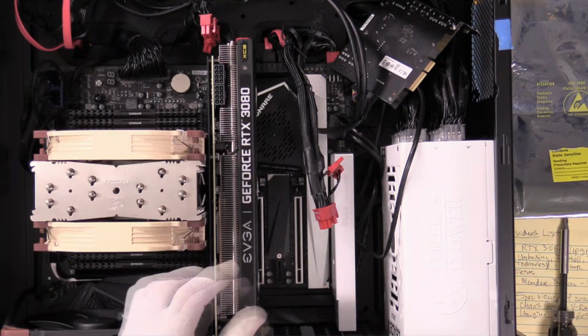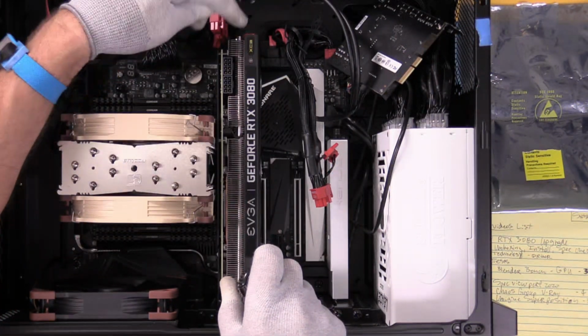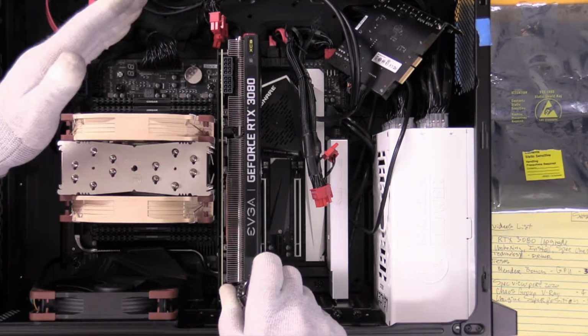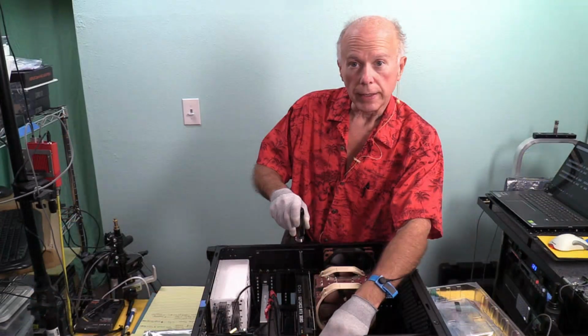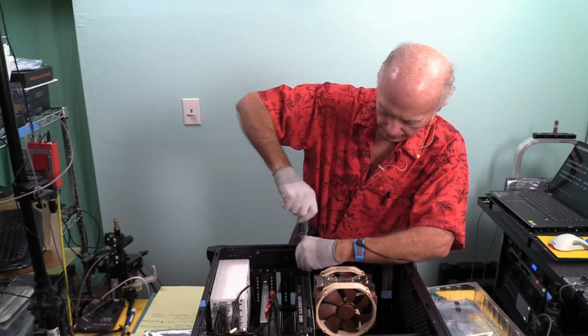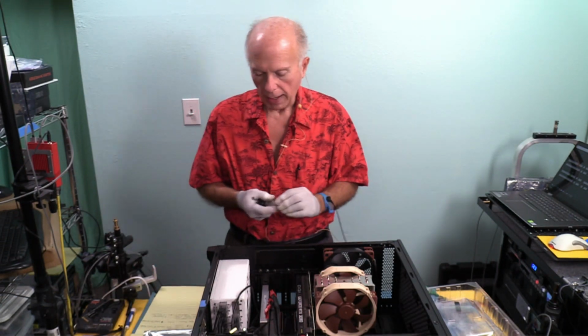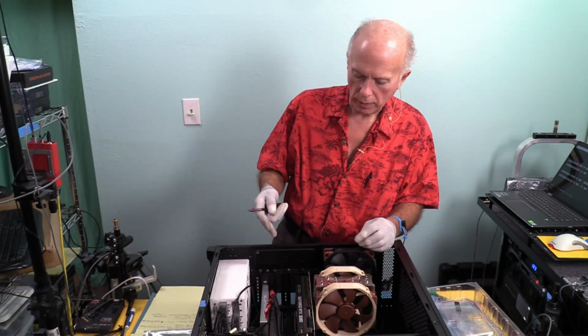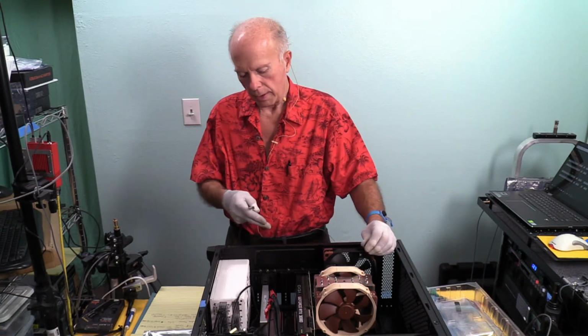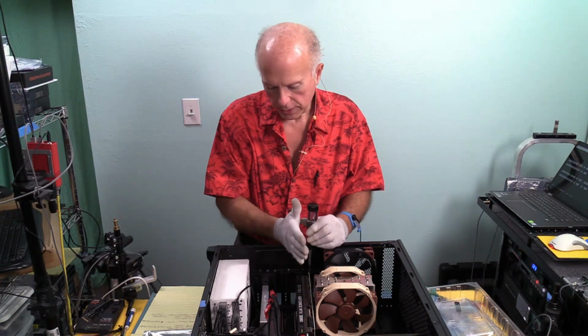So the video card's in the slot. We are secure. Now we'll get our two screws set. And because we're going to have to reroute the power to get it up over here, that means I've got to turn the case up and get on the other side. Well, to get on the other side of the case, that means that Thunderbolt card needs to come completely out. So change one thing, changes everything. But I would rather unplug the Thunderbolt card than to have it installed, get the BSOD, and have to deal with that. So I hope it helps looking at the slots and lane assignments.